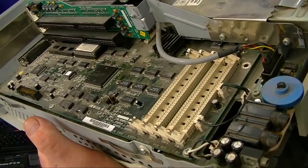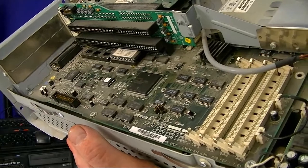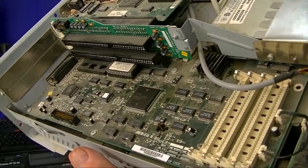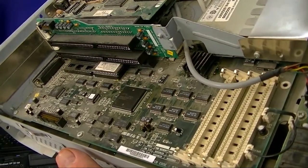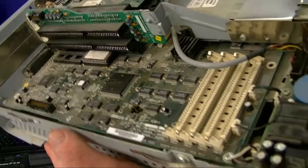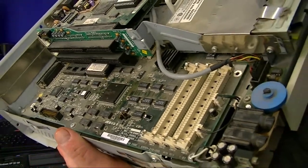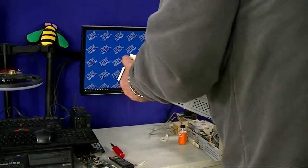William didn't go through and do the models of the EduQuest 35. And the EduQuest 35 differs from the 30 primarily in that it seems to have an IBM 486 SLC2 50 megahertz CPU on it. I think they just soldered in the 486 SLC2 CPU in place of that 386 SLC CPU. And so that is a good view of the one side of the planar.